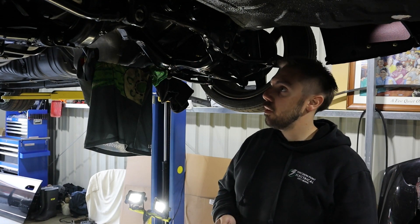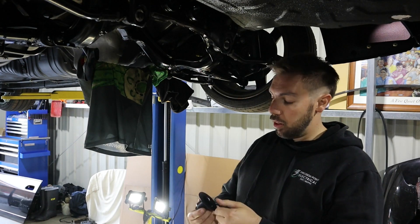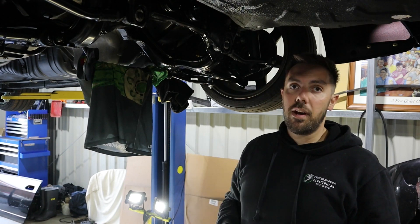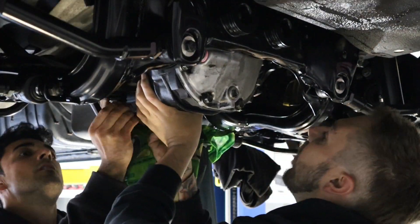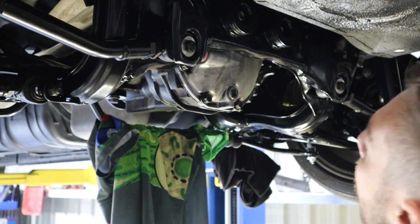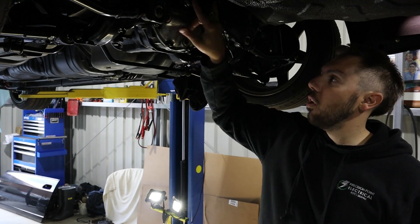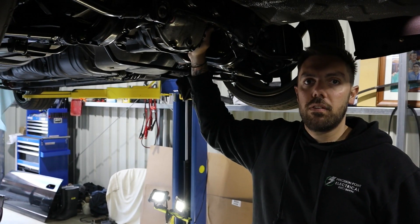We're just going to put it up into the rear subframe now. There's a little washer that feeds onto the mounting bolts on the back of the diff — that goes first — and then we've got this plate that slides in from the back into the bush, and then the factory nut on the back. Tighten that down, and then washer and bolts for the front mount. Me and Ryan will just bang that in now — it shouldn't take too long. The diff's in, everything's tightened up. It was a bit awkward back here but we got it done with the uni joint. We'll just connect the drive shafts and then it should be done.